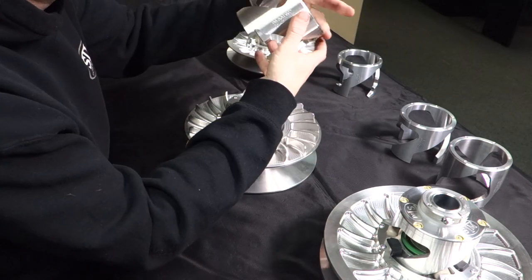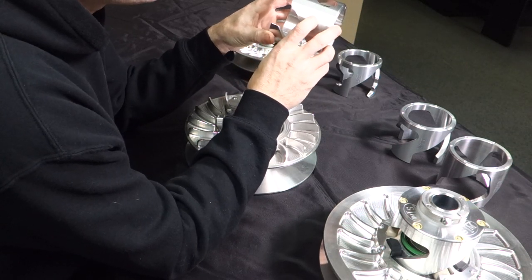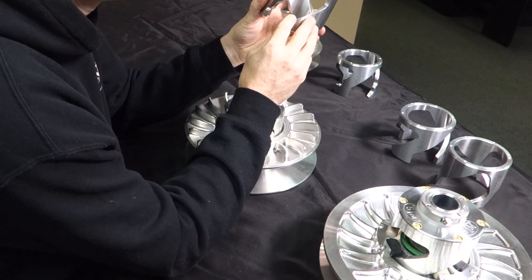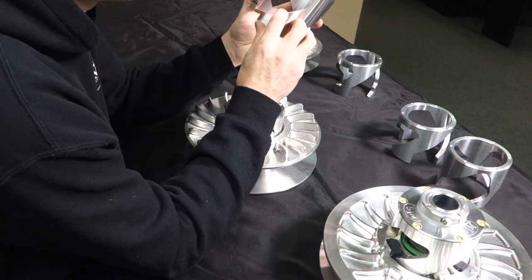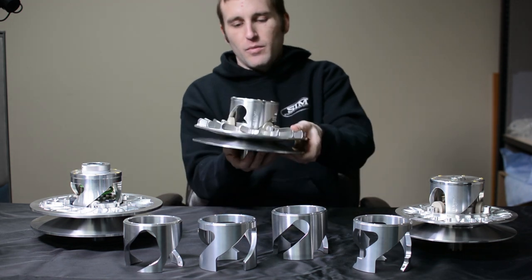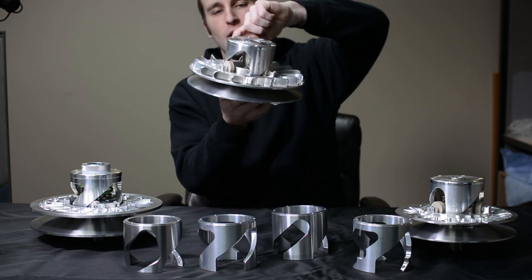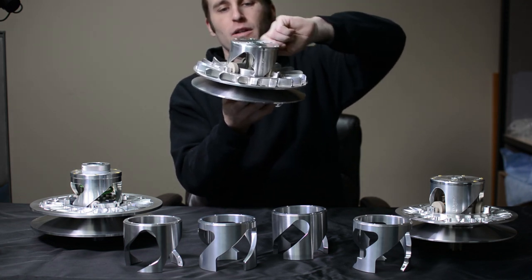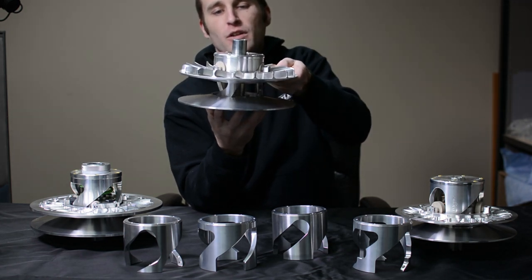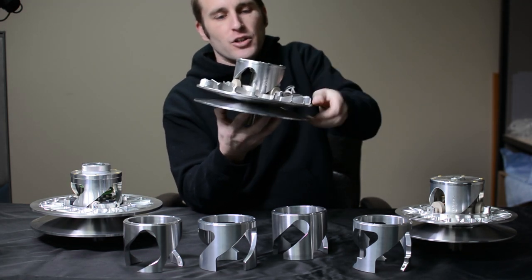Take this one for instance — this is a 35-45 encapsulated helix, so it's going to start at a 35 degree rate and finish at a 45 degree rate. Starting at a 35 degree rate means that as the clutch compresses — as we start down at the bottom of the shift — we're going to be running at a 35 degree angle, and then as we come up to the top we're going to be on a 45 degree angle. That different angle is going to change the load that the clutch applies to the engine as it shifts.